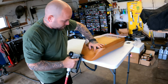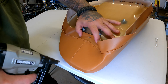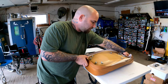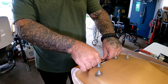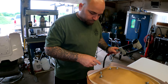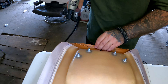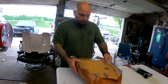Use the air stapler — don't try to do this by hand because this takes a lot of staples. Piece of cake. So that's one set, and you can see that sets our center. Now we'll turn it around. This feels like it could pull tighter and I'm actually going to pull that tighter because we do not want to lose seat cover. Now I'll put one down in there. Some of these spots get kind of hard to get to. That's started and you can see it's still pretty saggy all around.